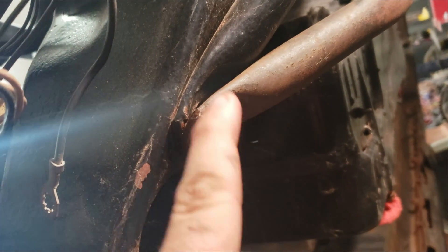This Grand National slash GNX bracing goes right back there. You do have to make your own screw holes because the Malibu and Le Mans back seat is a little shorter — the mounting holes are in a slightly different spot compared to a Cutlass, Buick Regal, or Monte Carlo, which fit more like what you see in pictures online. You make two holes and they join right in the middle.